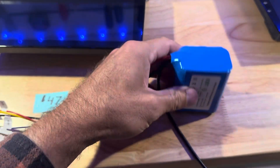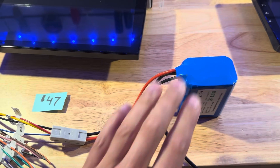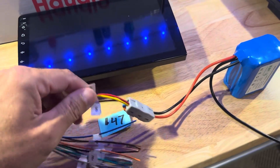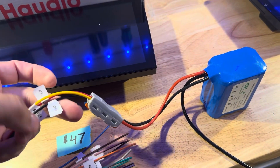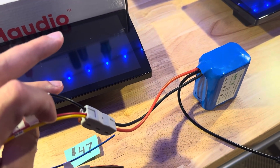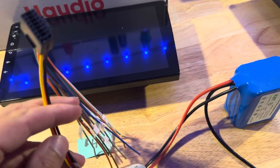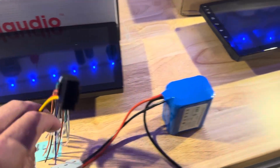To turn these on, I have little 12-volt batteries that are really handy around the workshop when working with automotive grade stuff. I've wired in the battery line as well as the accessory line, and the ground line goes to the other side. Battery is where it gets its main power, and the accessory tells the display that the cart is on and to turn on. I'm going to plug this pin in and boot them both up.